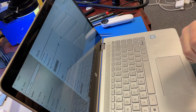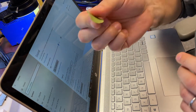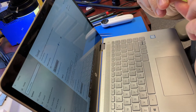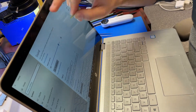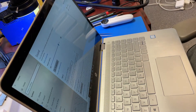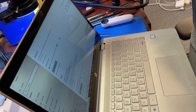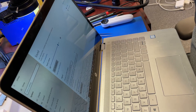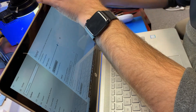So I started to check the board — the camera and microphone board. This is the way you open it: I used a guitar pick, 0.58 millimeter, and you just run it and get inside. There's actually a little crack on the screen — that's not from me, it was there originally. You run it between the rubber seal and the top cover, not within the glassy rubber but between the rubber and the top cover.